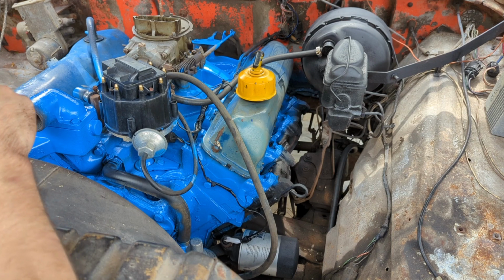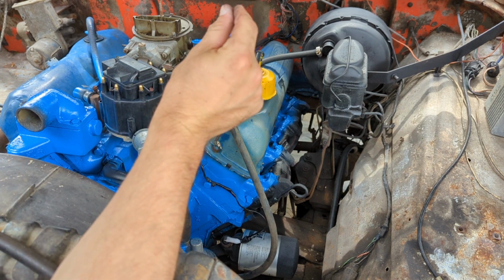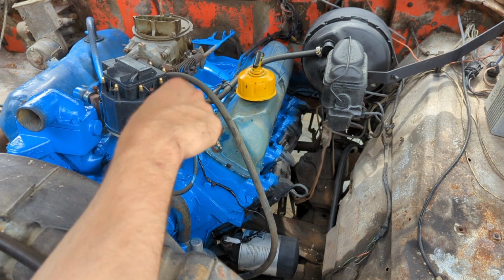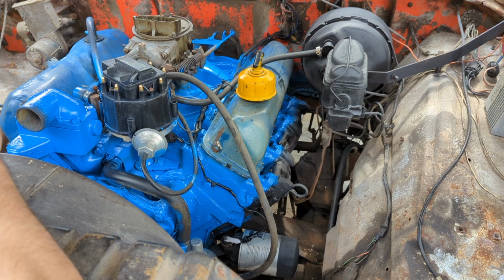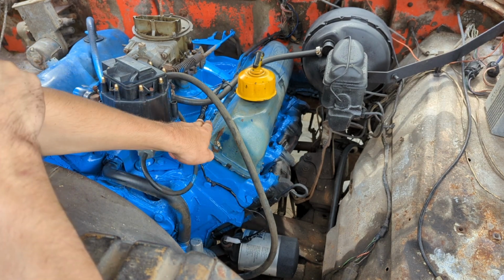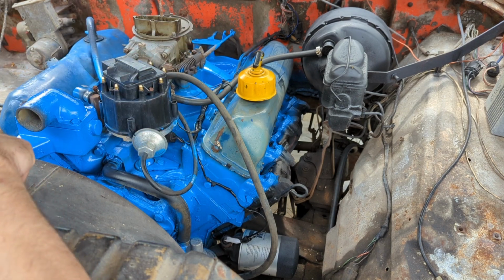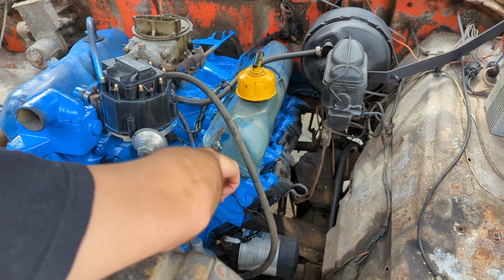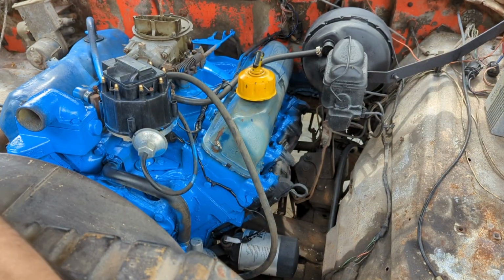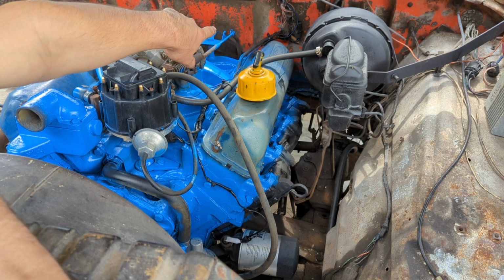So I did the slightly less right thing and put a test alligator clip on it from a set of test wires from Harbor Freight and bent them to the shape of that hex head so it fits on there firm. Put that onto the wire, electrical taped it all up, got it zip tied to a couple other things to help tuck it, put it on that bolt provision for the coil adapter there, ran it over, and tucked it all the way back to the firewall, got those big bulkhead connections tucked back and zip tied off to the back.